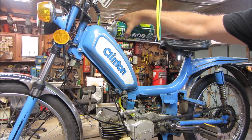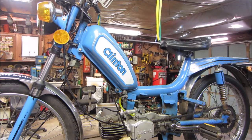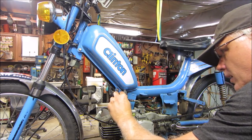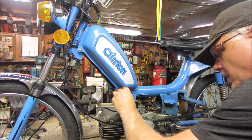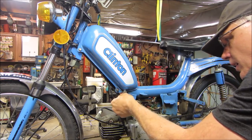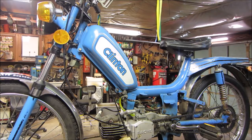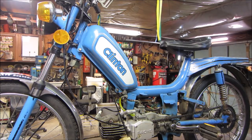We're going to go with 40 to 1. Let's see if that comes bleeding out of it anywhere. And let's go for on. That's good. Let's go for reserve. That's good. Let it push out whatever debris was in the bottom. I think we're going to be okay. Say we can hook that fuel line up. We'll tighten up the carb screw. Probably could fire it up, I think.